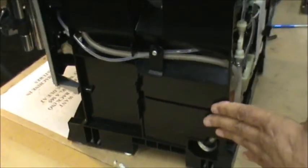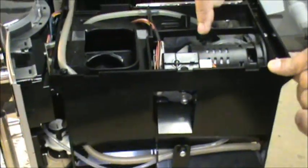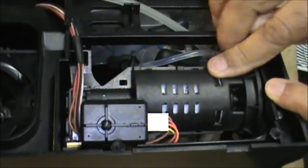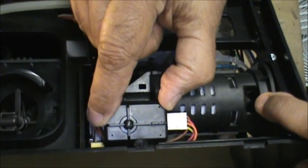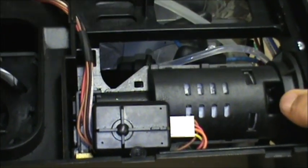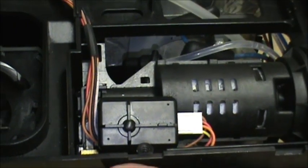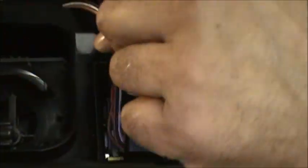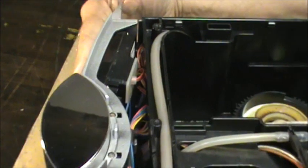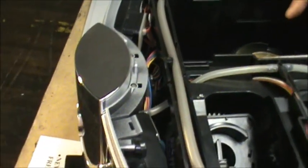On the right side of the machine you will see some tubes going out, but we will finally have to remove the front panel. On the top, you will notice this is the brew drive motor, which is a low-voltage DC motor at 12 volts. This part is the encoder, which controls the movements of the brew group from the home position to the brewing position and then back to the home position after the coffee has been made. This encoder has a harness of wires going to the front control panel and the LCD display window — this is in the one-touch models.